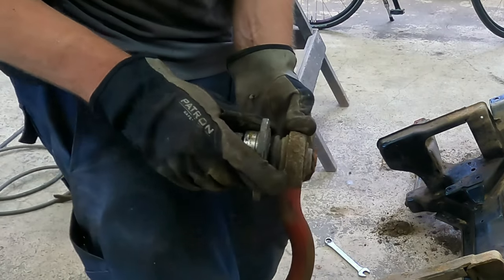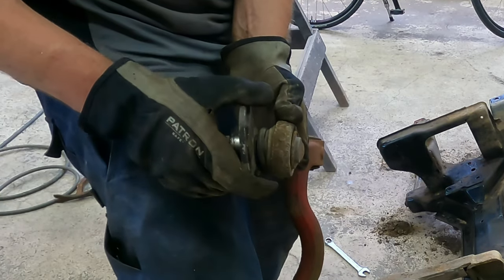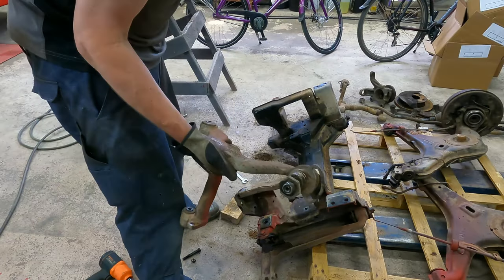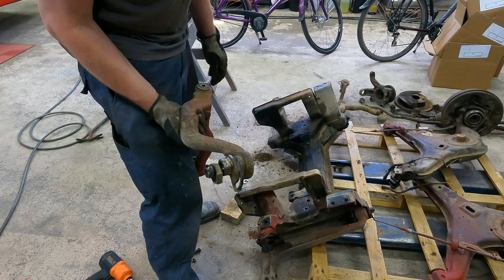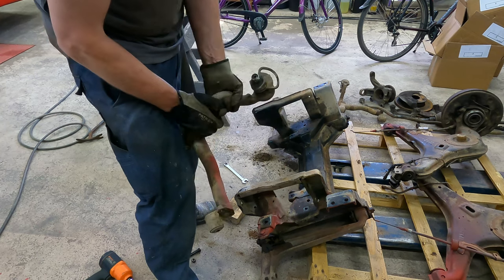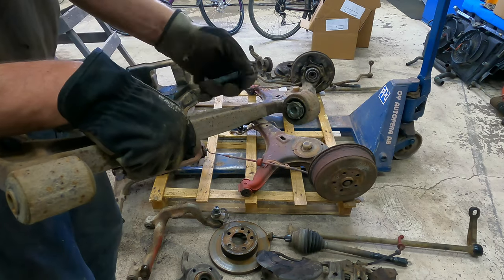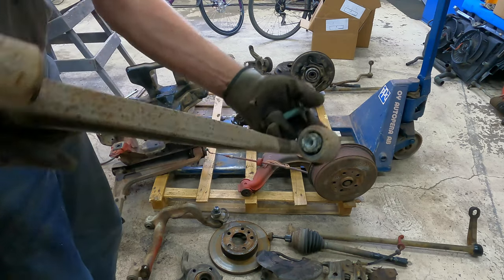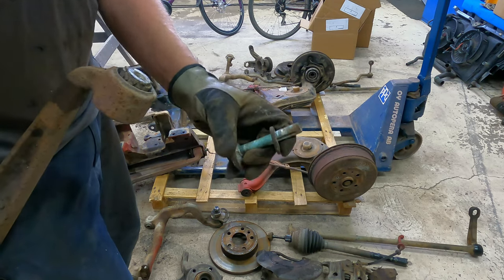And what about this joint? It feels a little bit loose, so definitely this one is not going to last a long time anymore. But I'm going to sandblast them first, then I paint them, and then I'm going to change the bushings. They are going to have some small scratches, but it's alive. Okay, this right hand lower control arm bushing was definitely quite worn. It's all rubber torn out there, and the bolt was a little bit corroded.